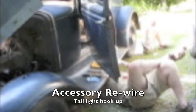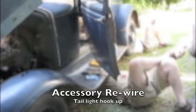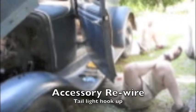Up the wiring harness, there it is. Cleaning the contacts on the brake stop switch. Dad's in the back putting on new bullet ends to make a joint to the old line to go into the tail light. We don't need the crossover harness, which came with the whole kit, because we don't have another tail light, but that's alright, we'll figure out something to do with that. I'm using a little contact cleaner to clean up the electrical contacts here. They're a mess under here, of course, with that Louisiana buckshot all over the bottom of the car.